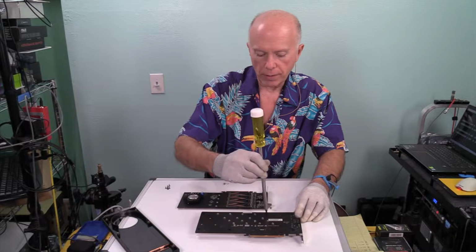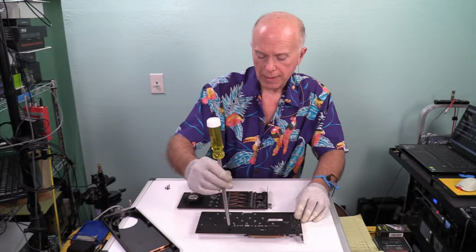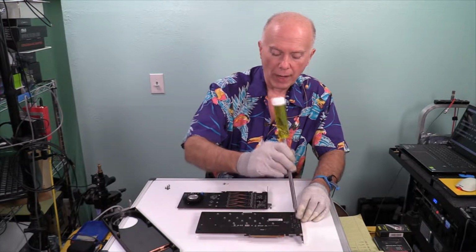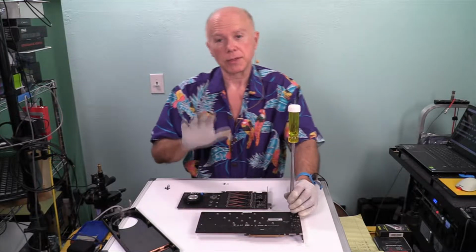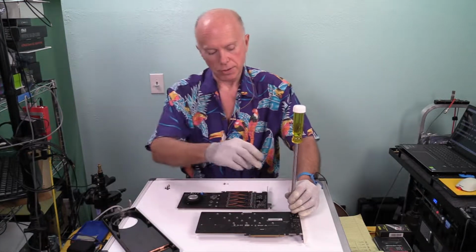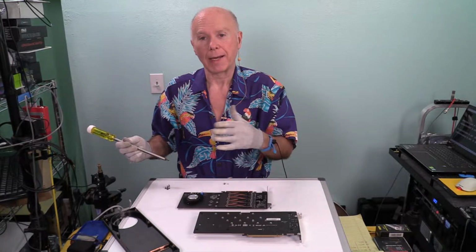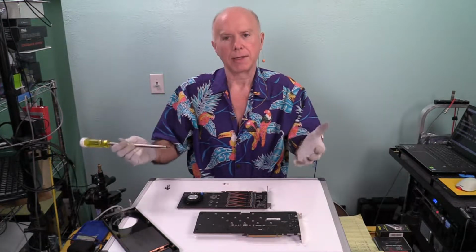Now, I did not mention it in the last video. I always do, but bifurcation is a key to making these work. I even had a comment, someone asking, why don't you do this on an X570 chipset? Well, we may do some stuff more as it relates to the X570. The problem is the X570 is a great chipset on paper, but the implementation is just, there's no dedicated resources. The way PCI Express lane and slot assignments are allocated on the X570 chipset is not conducive to the kind of things we want to do.